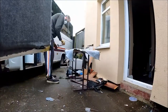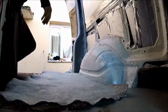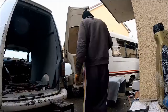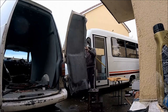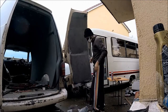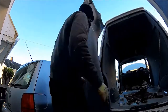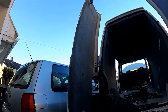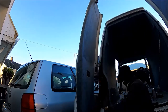If you're carpeting sliding doors or rear doors, just carpet up to where the rubber meets the inside of the door. The arches are really simple - just a small piece of carpet per arch, stretch and fold it to the contours. Close the doors and draw around the inside where the rubber meets the door, and carpet only up to that marker. Otherwise if it rains, water might seep in past the seal and get the carpet wet. Always make sure carpet is trimmed back to that point - you don't want any carpet going past the rubber seal into the exposed environment.